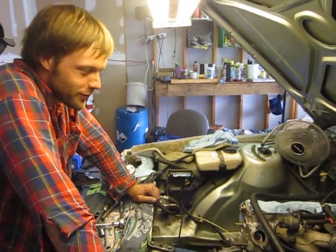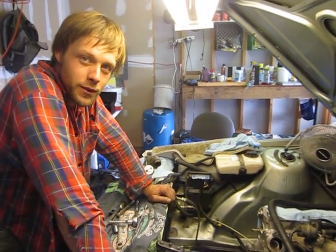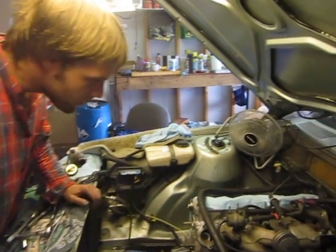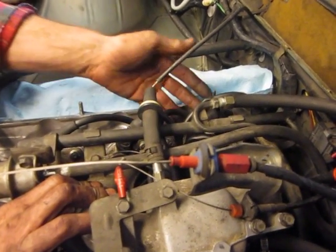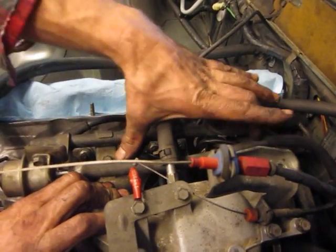Good job. The next step is we're going to finish hooking up the fuel injection — you're halfway there. At this point the intake manifold is in, and we've connected the injectors, and we've started with the flame trap. We've got a wire loom in place and our grounds.